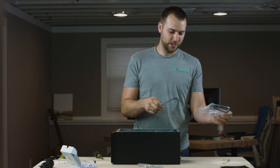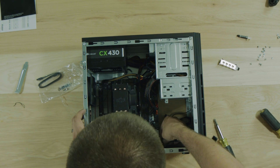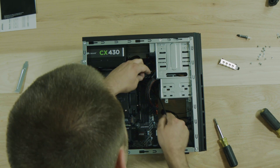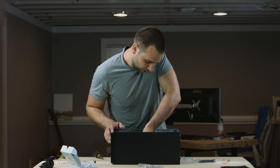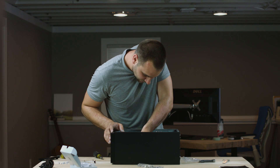We're just about done. Last thing is to hook up the CD drive to the motherboard - it comes with a little SATA cable for that. There's a whole bunch of SATA connections over here - this is literally the only SATA cable connection we're going to use. For CD drives I use the higher numbers, so I'm going to use spot number six. Run this cable through and plug it in right next to the power connection on the CD drive. And there you go, we're all set - that is a built computer.